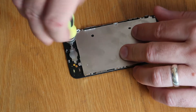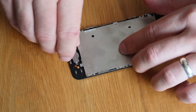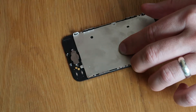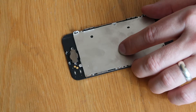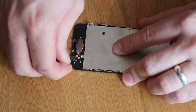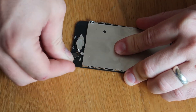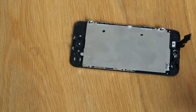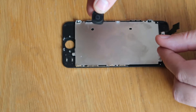That's everything at the top disconnected. Now we'll do the bottom home button — again, one screw, two screws. This is stuck down under the two little prongs over here. Sometimes you can get lucky and it will come up, sometimes it won't. The way I've always got around this is you can heat it up, or I tend to just use a little blade. If it doesn't come — just be really careful. And if it doesn't come, prepare to break your home button. Then pop your button out — that's our home button, we're going to transfer that over.